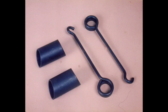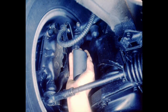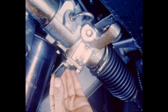Jaguar alignment is checked with the vehicle in the mid-laden condition. This requires the use of special tools BLT-5023 and BLT-5024. After the vehicle is situated on the alignment rack and resting on the sliding wheel plates, install the special tools as you compress the suspension. Fit the front tubes under the upper wishbones, and fit the rear hooks between the rear mounting and pivot nut. The front wheels must be set straight ahead and held in this position by inserting centering pin BLT-1058 in the steering rack grease fitting or blanking plug bore. Caution: be sure the pin fits freely into the rack center detent and do not move the steering with the pin installed.